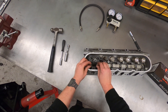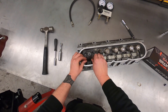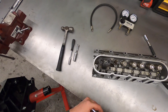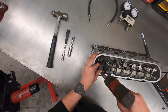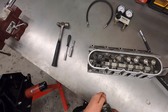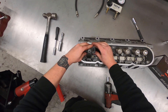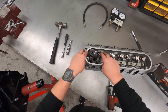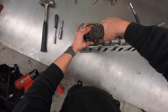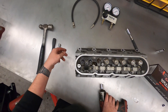You just need two bolts — if you buy the tool it comes with them. We're going to go ahead and snug this down. The idea behind this tool is pretty simple: you want to center your valve springs over the valve so your retainer has a clear path straight down. You tighten up this pedestal bolt and as you can see, it compresses two springs at the same time.